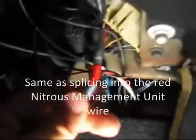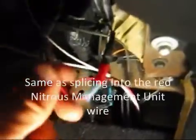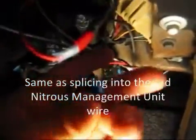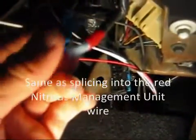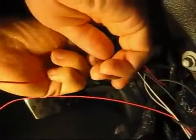The red wire from the window switch is for a power connection. You will need to connect the red wire from the window switch to the lead from the arming switch that does not have the fuse assembly. When the arming switch is flipped to the on position, then the window switch will get its power. Using a splice connector makes this a very easy process.